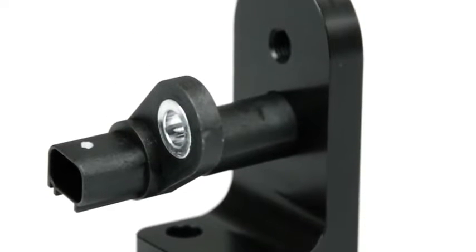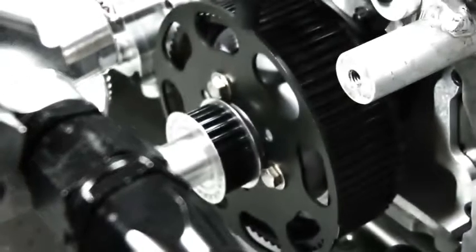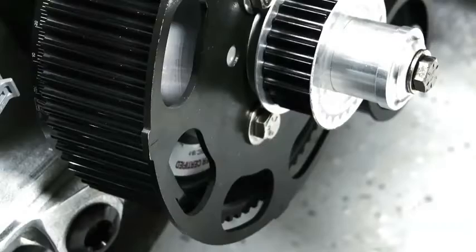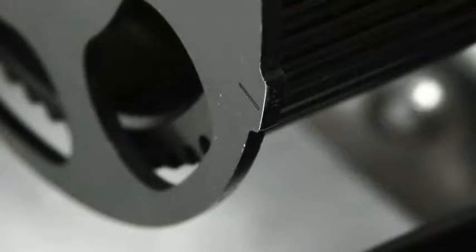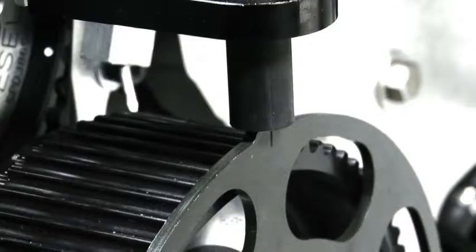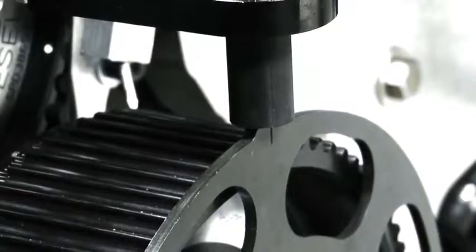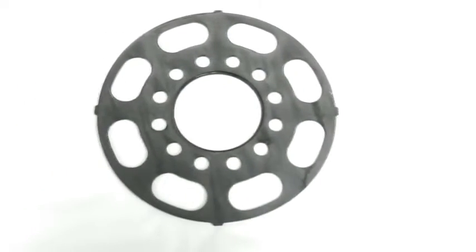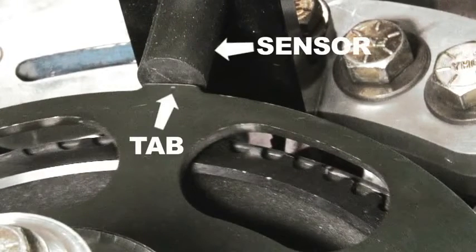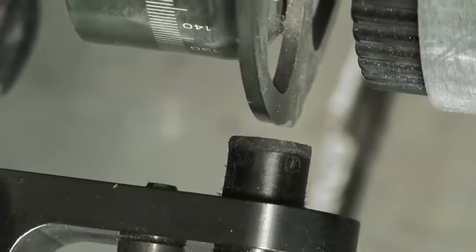The Fast Crank Trigger is simple. The crank trigger wheel is bolted to your crankshaft's harmonic balancer and the Fast Inductive Sensor is attached to the engine via an adjustable bracket. Metal tabs on the outside of the crank trigger wheel trigger an inductive sensor as the crank rotates. There are four tabs, so the sensor gets four electronic signals each time the engine rotates, allowing your ignition or EFI system to know precisely what your engine's RPM is.